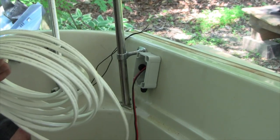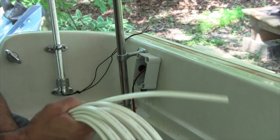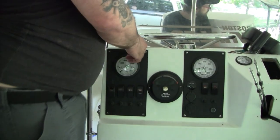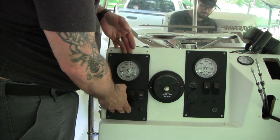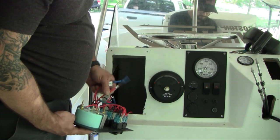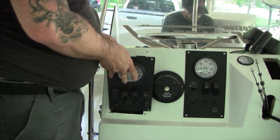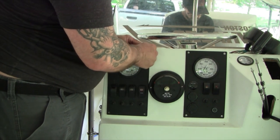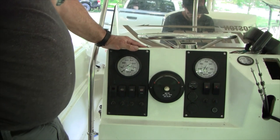On to the fun part — I'm going to run this triplex wire from the back of the boat to the front, up to the console, get the console connected up, and then do our magic back here. For those of you who saw the console panel video — here's a link — I left two female bullet connectors marked for the anchor light, stern light, and bow light. The key is just running the cable up to the console neatly and terminating it with two male bullet connectors and the ground.